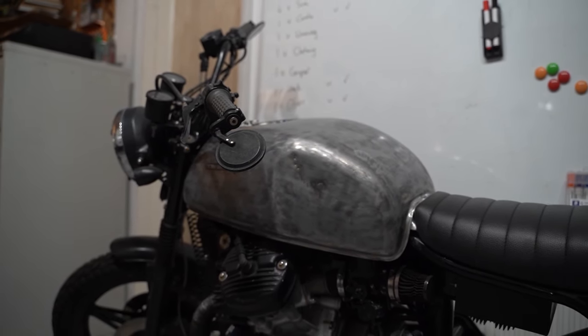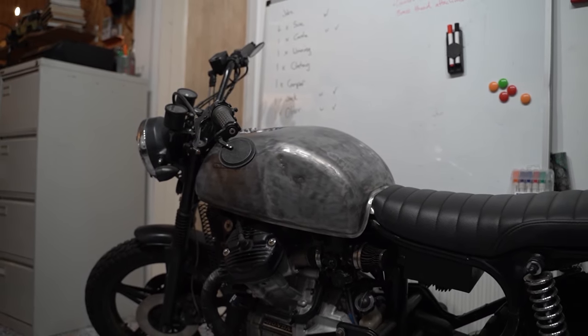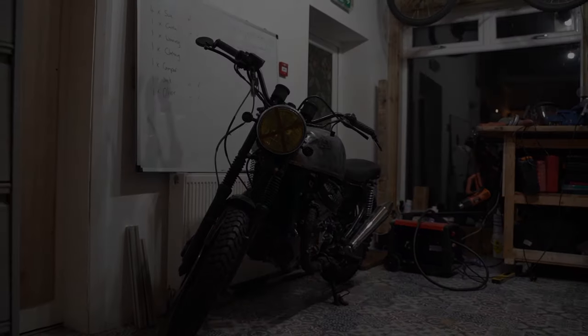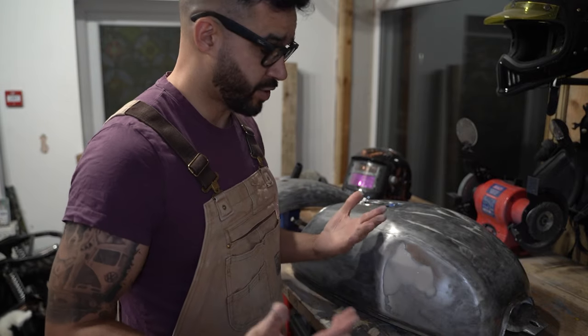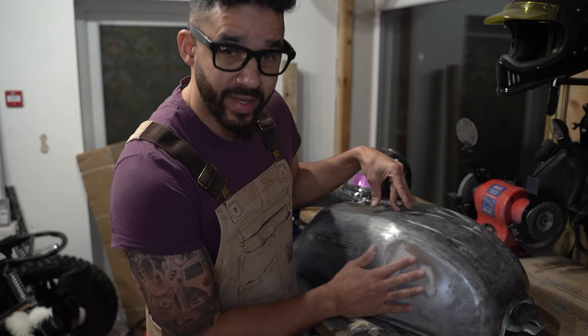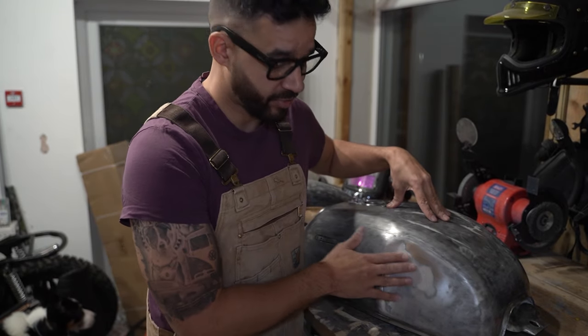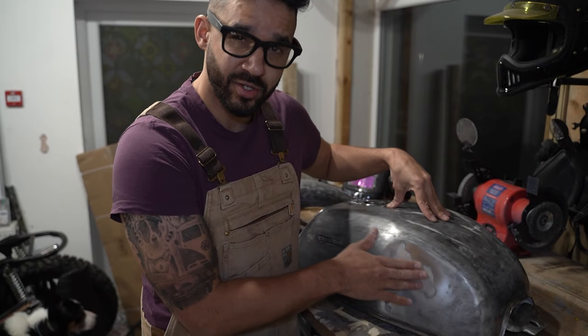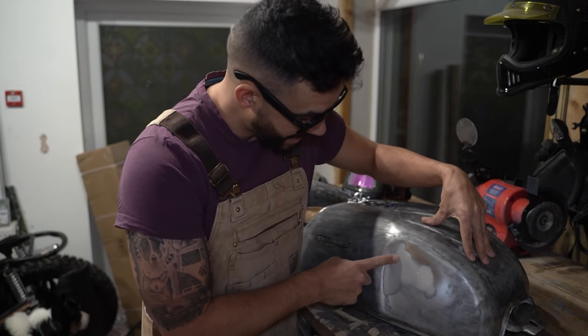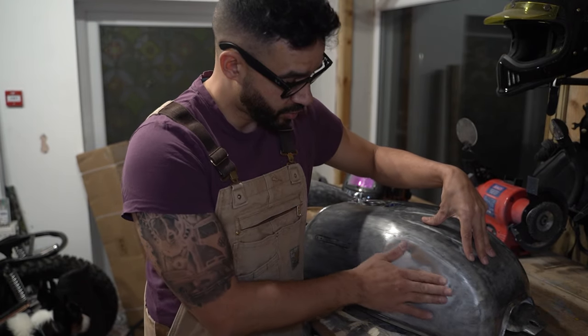After quitting for the evening I realized about an hour later that body filler might take a while to set, so I came down in the middle of the night, laid on some body filler, and let's get back to the next day when that had set. I've never actually worked with car body filler — literally the first time doing this. I can see I'm going to have to put another coat over the top; I've gone a bit too deep in places and I can also see where I haven't pushed out my air bubbles, which is obviously super important for a good finish.